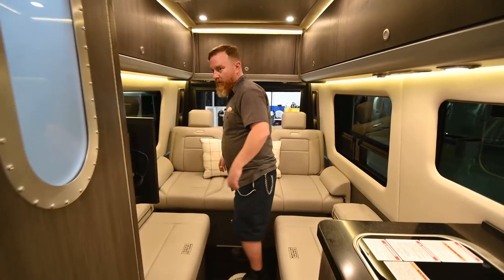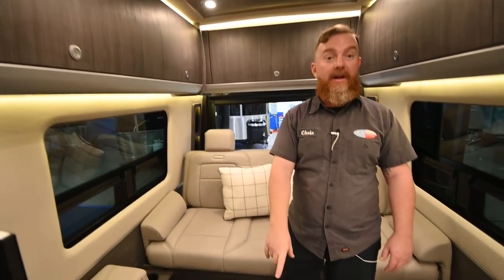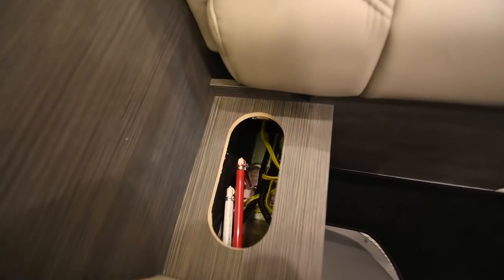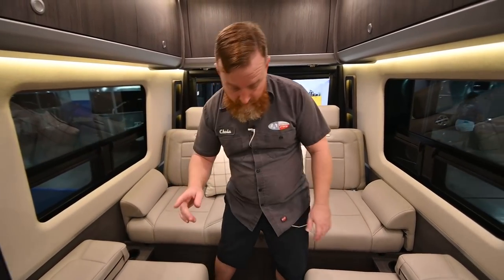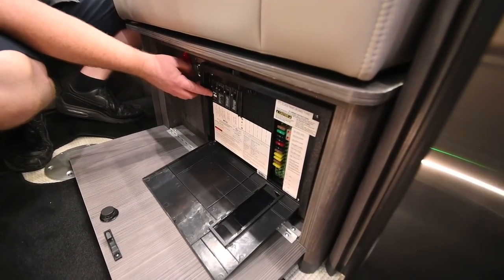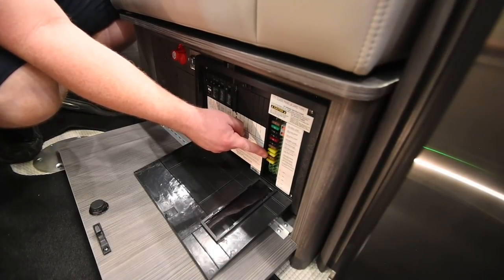Back here, we've got another Firefly panel around the corner. Up top, you've got a carbon monoxide and smoke detector — it runs on two AA batteries. Down below is a carbon monoxide and propane detector that's hardwired into the house batteries. On the curb side, underneath the cup holders, is where you'll find the low point drains for winterizing — two white valves in there to help you winterize. Down on the driver side is where you'll find the fuse panel and breaker box — AC on the left, GFI reset here, DC on the right, with all fuses listed on stickers. There's a red LED light that will shine through the window if a fuse is blown. There's also a master battery disconnect and a keyed slot to turn on/off the Airstream connect upgrade.